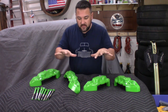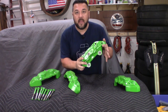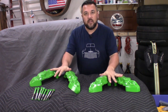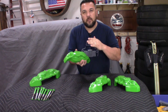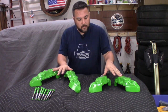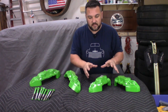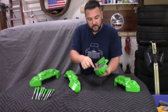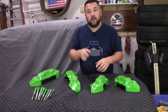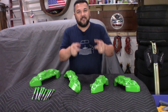All right everyone, that's going to be a wrap for this video. As you can see, the Brembo calipers came out 100% perfect in lime green from Eastwood. These things are powder coated all around on the fronts and backs of the calipers. All Robert has to do now is bolt these together, reassemble them with the pistons and seals, and they are 100% good to go. These things look absolutely mint. To go over everything that happened: Robert disassembled these before bringing them over. We then sandblasted all four parts, threw them in the oven for outgassing to get all the oils out of the metal. Once they were done with outgassing, we taped up all the spots we didn't want powder coat on - especially the mating surfaces and inside the pistons - with heat tape, and then we sprayed them with powder and baked them in the oven. If you liked the video, please give it a big thumbs up, like, share, and subscribe. Smash that notification icon so you know when I post future videos. I'll see you in the next one. Thanks for watching.